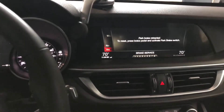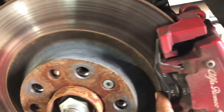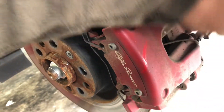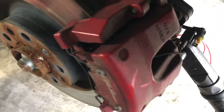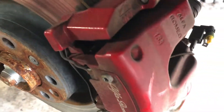Now we're gonna replace the brake pads. I'm gonna use the procedure of any regular car — since it's already released, it's just opening these two bolts, pressing the caliper back, and replacing the pads and putting everything together. The size for this is a number seven Allen key.